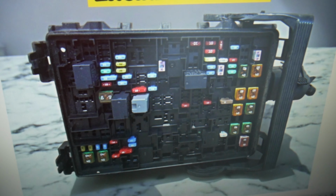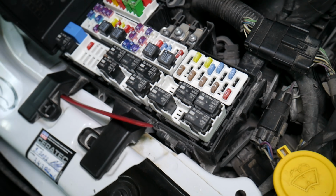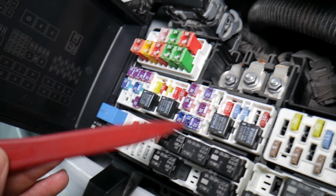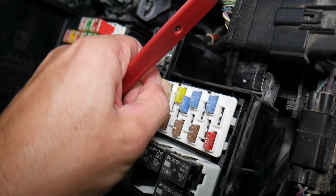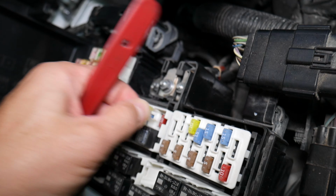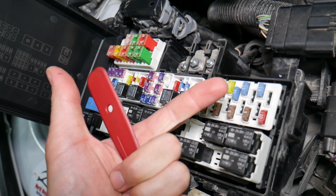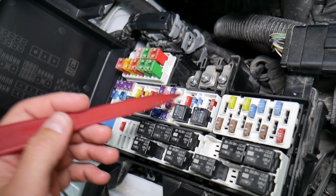Before we continue, let's explain quickly why it's always a good idea to test fuses and relays. It is, guys, very important to test fuses and relays. On those fuses you cannot clearly see if they're burnt or not, especially in the J-case fuses. Let's say you remove a fuse, you look at it and you assume, guys, that it's actually a good fuse, but it's actually a bad fuse. Sometimes you cannot clearly see that. What can easily happen at that point is you put the bad fuse back in and you start replacing parts and tools that you don't need to, so you lose your time and your money to fix a problem that doesn't exist, when all we had to do is test the fuse and replace it.